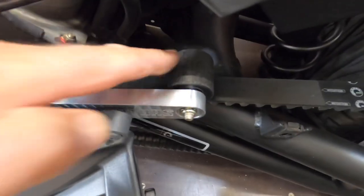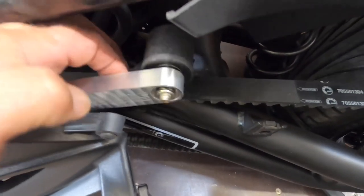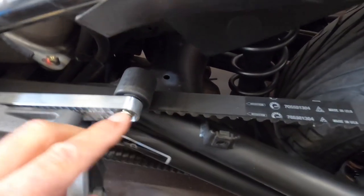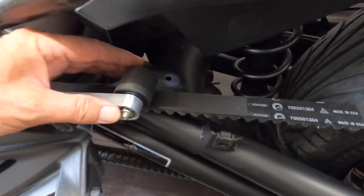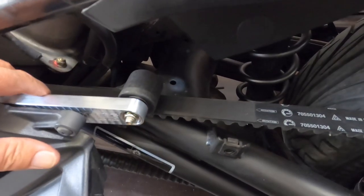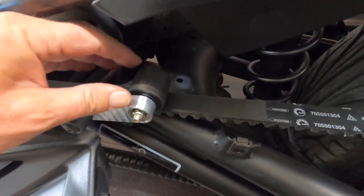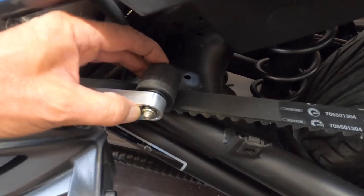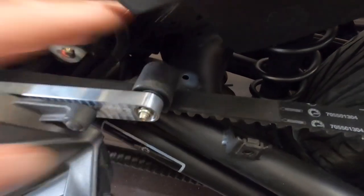This is whether the tensioner works. We take it for a ride, give it a bit of a run, and see if it did solve the problem or not. So we'll head into the workshop and have a look at it actually fitted on the bike. The belt tensioner is fitted, and you can see if I just put my fingers under here and give it a lift — you can see it's spring loaded and what it's actually doing is just pushing down on the belt. One of the things to be careful of when you fit your belt tensioner is to make sure that you get this roller on top sitting square on top of the belt. The bolts and the sides of the elongated holes in the mount bracket do allow it to move either side, so before you do your final torque on the bolts, make sure that you've got it sitting square on the belt.